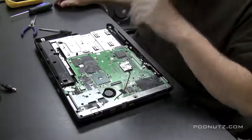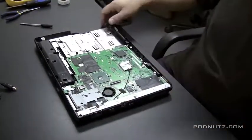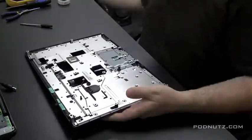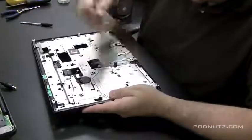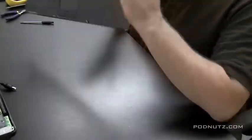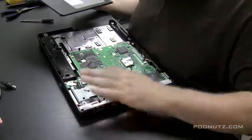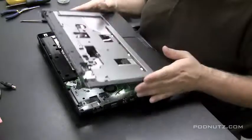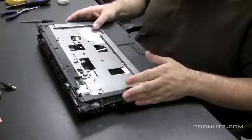The wire might be jutting out a little higher than the original solder connection, so we want to be extra careful. As you can see, the whole upper case is metal, and if that positive wire we attached touches that metal casing — which is ground (negative) — we'll create a short circuit. So if you feel the least bit apprehensive about it, cover your work with electrical tape and you'll be fine.